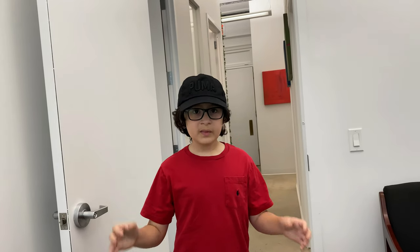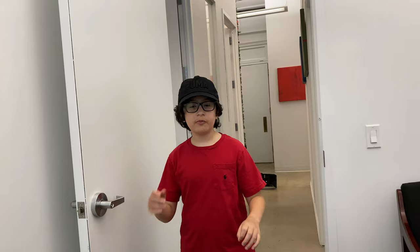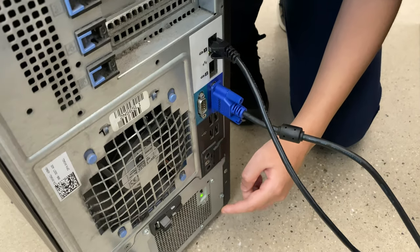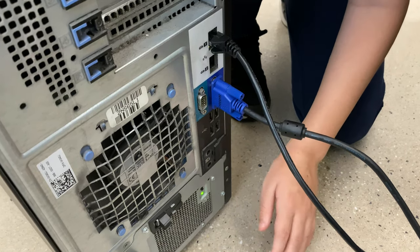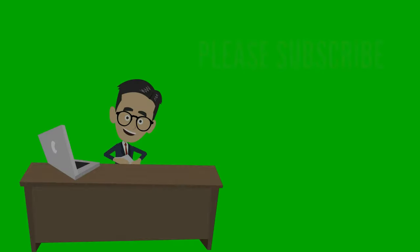For a recap: if your machine is not powering on and the power button does not work, before you buy a power supply, hold down the rear PSU button for 15 seconds to test the power supply. If the indicator is anything but green, then the PSU is failing and you'll need to buy another one. If it's not that, then powering on with that button should power on the system by itself.